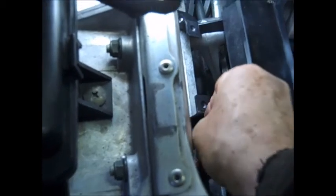Put the bolts in on each side — I usually put all of them in finger tight first and then tighten them afterwards to make sure they fit good. This is where I use a 12-millimeter end wrench to tighten these up — one on each side and then two down here on the bottom. All four of them hook to the frame.